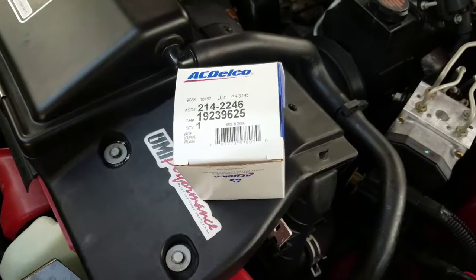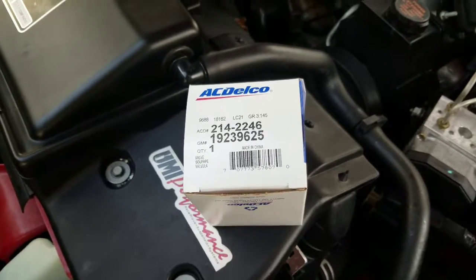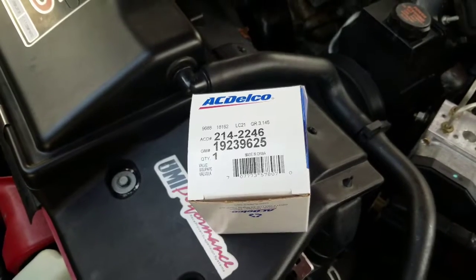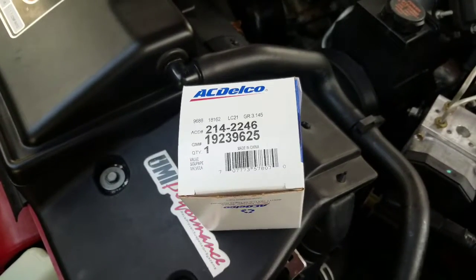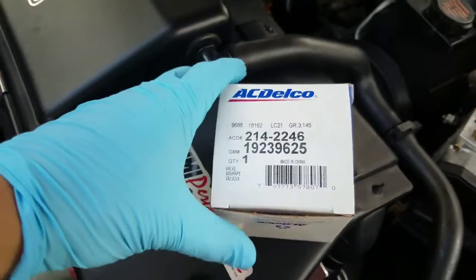Today on non-sponsored Bunk Ass Mechanic, I'm going to replace the purge solenoid for my EVAP system. Turns out the 2001 and 2002 Camaros don't have an EGR. My car has been throwing a code and it's been rough idling. So I'm hoping it's this part right here.